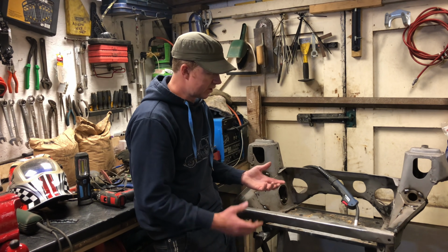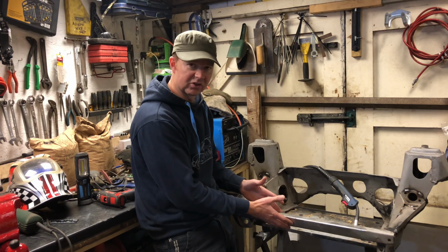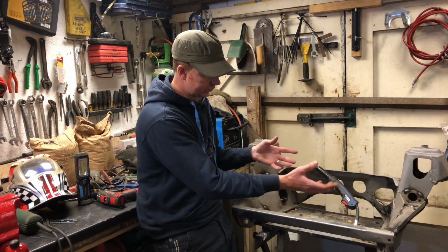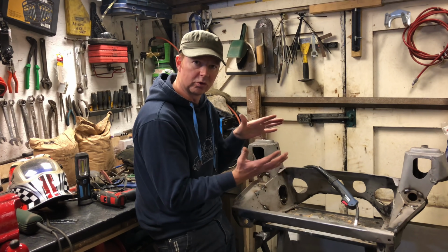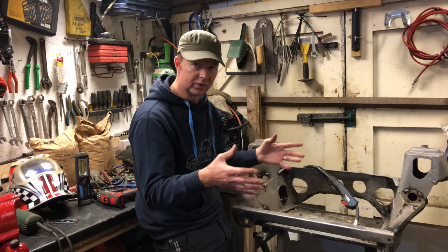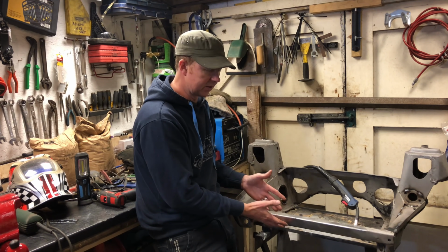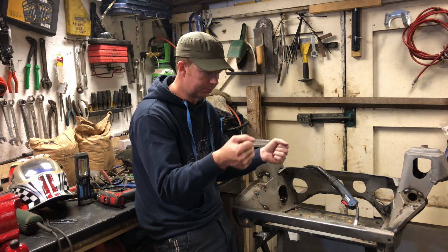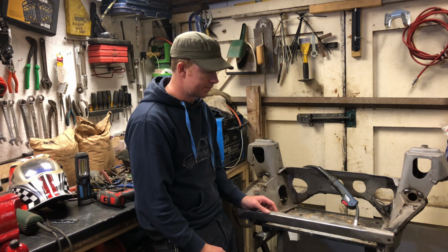All that welding really helps out with that. So if you imagine the car, you have the shell of the car, and then the subframe is attached to the shell, and then you have the suspension which is attached onto the subframe. By eliminating any play between the subframe and the car, by welding all those areas up and putting solid mounts between the subframe and the car, that keeps the subframe and the car as almost one solid piece. That allows the suspension to do all of the movement, and all of the geometry of the suspension will stay correct, rather than being altered by the subframe having any kind of play in it. Obviously that play will be very small, but it'll give you that extra positivity with the steering, really nice positive steering. Same with accelerating, braking and cornering. It just will make a difference.